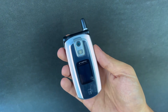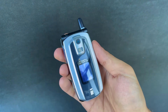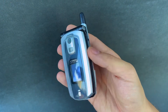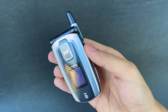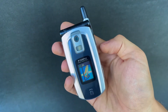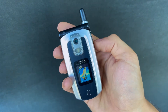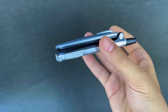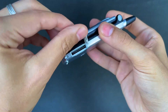A little bit about the F505i: it is part of the NTT MOVA series, it's a 2.5G PDC device running on 1500 MHz, and it is not compatible with GSM — there's no SIM card in it. The external screen is a 256-color display, and we have a 1.2 megapixel camera with a flash on board. For expanded storage, we have a mini SD slot.